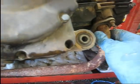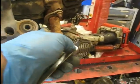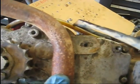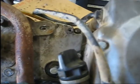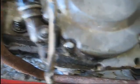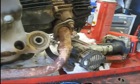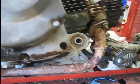Next order of business is putting this exhaust pipe on here. This thing is pretty aggravating to get this bottom bolt out, so I'm going to get it started first and probably end up using a ratchet wrench to run that one in. This other one, naturally, you can get with just a socket. And what we're trying to line up here is this bolt hole. This is where the shifter bracket goes in. I'll be putting that on next, but it's pretty tight here, and you can't get this exhaust off with it still on the bike. It's pretty complicated, so I just figured I would take it off on the bench and put it back on the bench. That'll make it a little easier. Alright, let me get that put on there, and then I'll cut the camera back on.